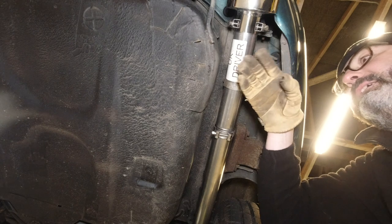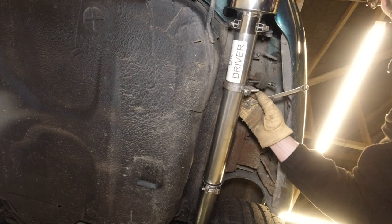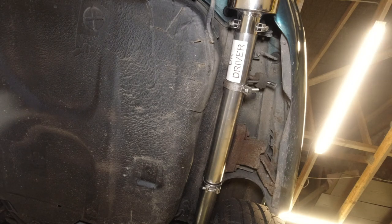And then when we get something like approximately the right position, you can rotate the tail trim, which again is why it's important that this is a separate piece, and start to tweak and maneuver. You've also got how far the exhaust is pushed onto the overaxle pipe, and if you pull it further out, then you rotate this way. Okay, it's approximately right.